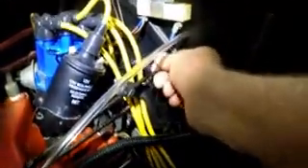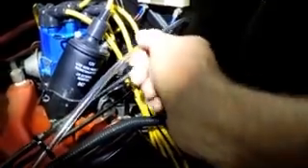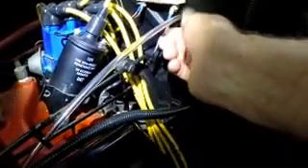What do we have next — oil pressure. That is way back here. See this little plastic sender? It rolls down — there it is back there. That screws right into that spot. Then I ran the plastic oil line through the firewall, same spot as the tubing for the manifold vacuum. That's everything on the outside.